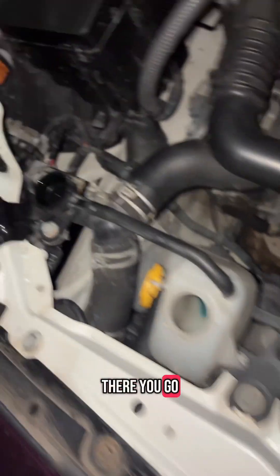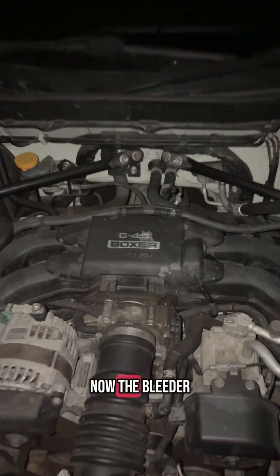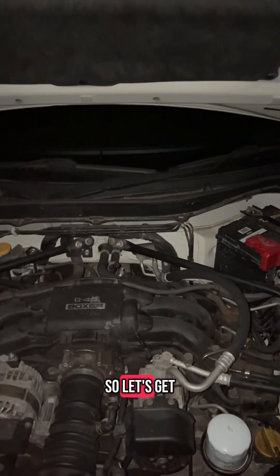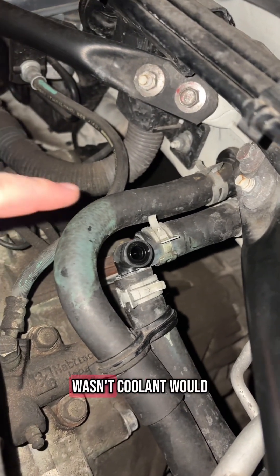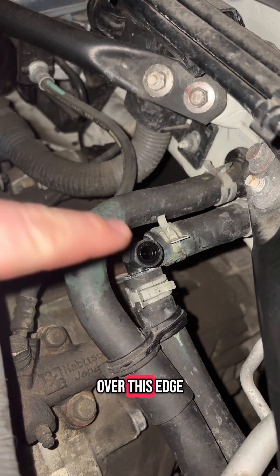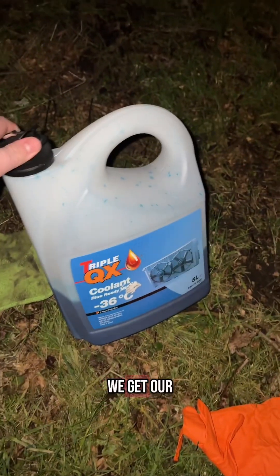You can see there's only a bit of coolant in there. The bleeder screw is located just here on the GT86, so let's get that off. Now we can see that there are in fact air bubbles in our coolant, because if there weren't, coolant would be slowly spilling over this edge.